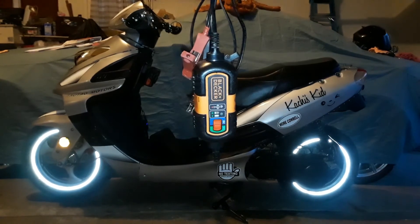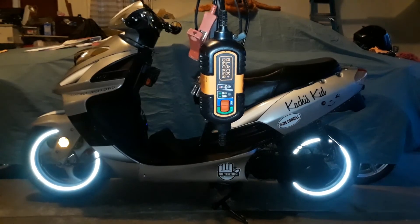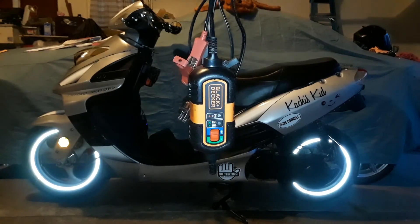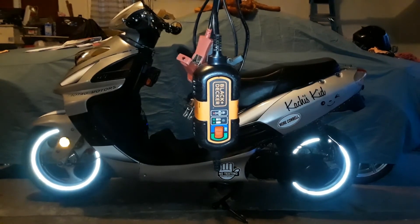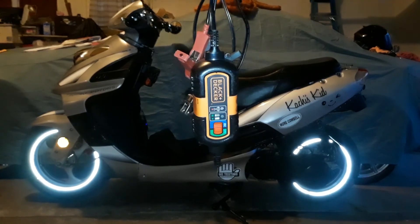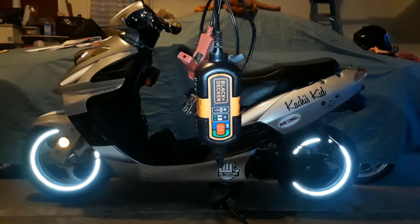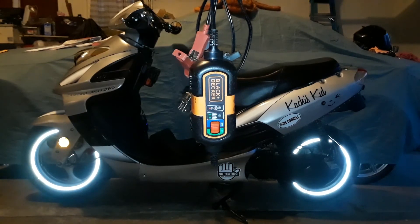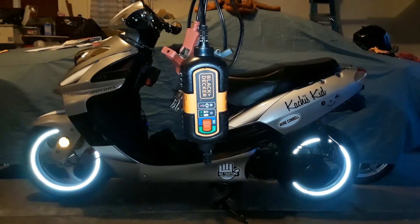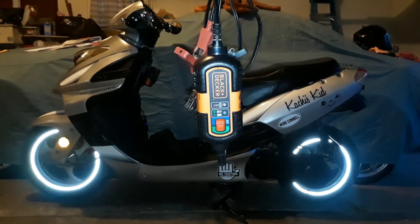The fourth thing I'll do to winterize the bike is hook up my battery tender. Now within the community there's a lot of discussion — should you take the battery inside the house or leave it outside? I've been under the notion that because car batteries survive the winter on the outside, leaving them outside wouldn't be too bad. That way no acid will leak from the battery inside your house. But if you feel like taking them inside, I understand that also, because you can keep an eye a little bit better on the battery tender. You definitely want to have a battery tender, charging that battery either periodically throughout the winter or leave it on there for the duration of the winter.